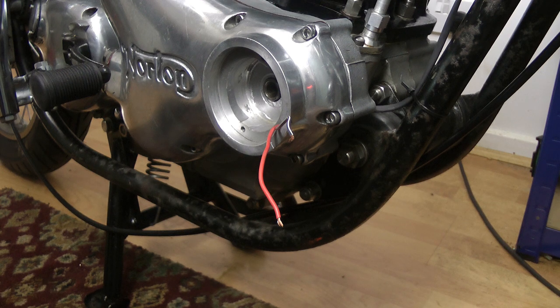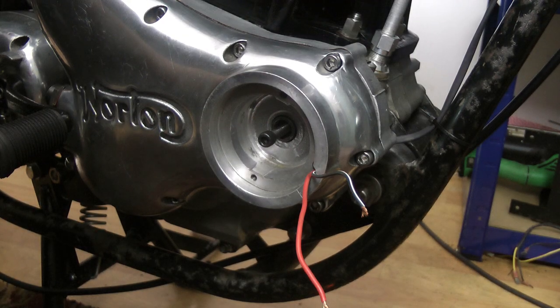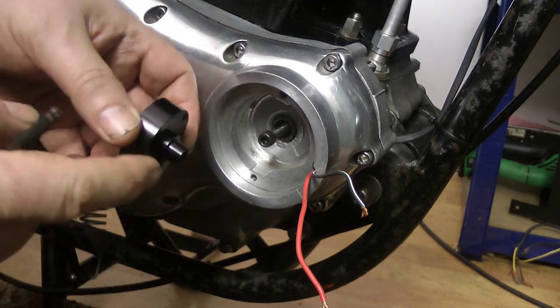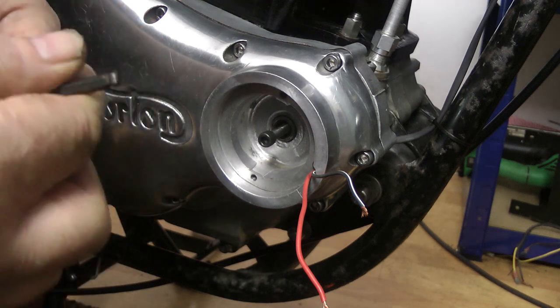Don't just rely on the ignition switch. They have proven to be a little bit unreliable, shall we say, even though it's a genuine Lucas, well, supposedly genuine Lucas one in a Lucas box and all the rest of it, to arrive faulty. One of the preliminary checks Trispark asks for is to identify which Allen screw fits into the camshaft, and to make sure that it's not going to bottom out before the taper on the rotor is engaged, so that the rotor could actually spin willy-nilly as it will.